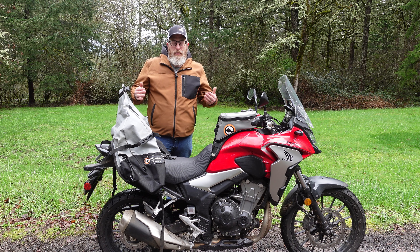If you have a larger bike with a bigger tail section or you need more space, you can always swap this pronghorn strap out for one of our orange pronghorn straps — the longer ones — and it'll give you plenty of room. Now that I've got the back attached, I'm going to go to the sides and put those front straps on. What you're looking for up front is a place to attach the strap that is more or less at a 45 degree angle. This Coyote bag sits at about a 45 degree angle — it's the more horizontal of our two rackless saddlebags. The Great Basin is more vertical, and if I was using a Great Basin I would go to the hook on the passenger foot peg mount. But because I'm using the Coyote, I'm going to go to the front of the rear passenger peg mount, which gives me the maximum strap length.